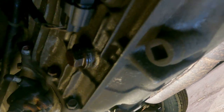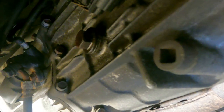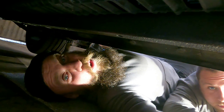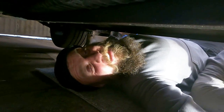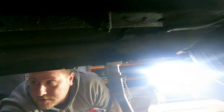Under here you can see there's your drain and your fill right next to each other — handsome. We'll crack the fill off first, because if you can't fill it up after you've drained it, you're screwed. Always crack your fill nut off before you drain.